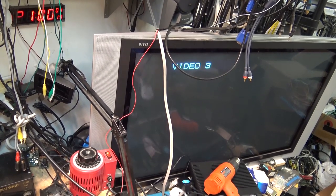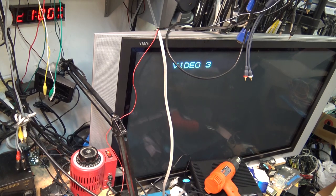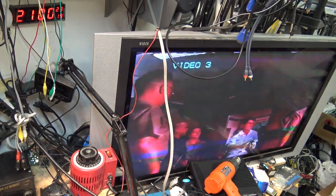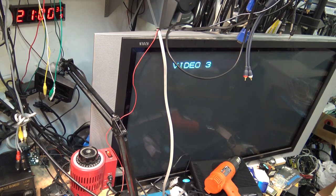I've got a tape in the machine — a pre-recorded tape in 8mm. I have no picture. If I put it in pause, I get a very distorted picture, very bad, all dark. If I go to fast forward, as you can see this unit has a problem, and that problem is going to be capacitors. We'll take the unit apart but it's likely not going to be repairable.